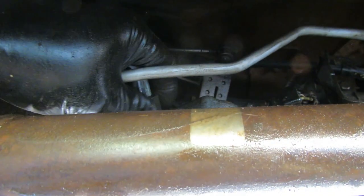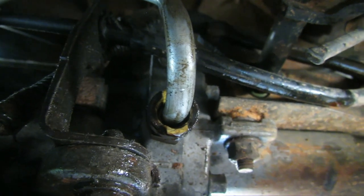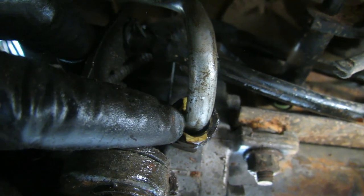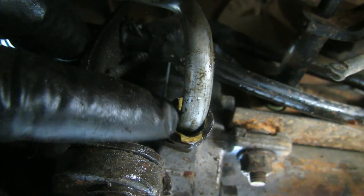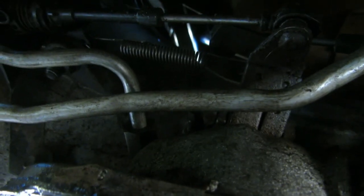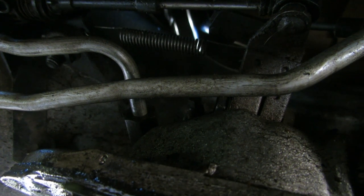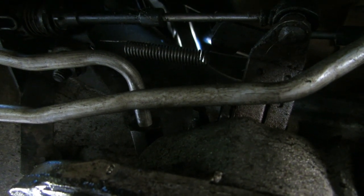This is going to be a 19 millimeter again on this nut. I wanted to show you — the line is not fully installed until that ring is fully seated inside the connector. I thought it was all the way in, double-checked, thought it looked a little off, and went ahead and fixed that. Now it's all the way in and this can't come out. I got that tightened down — 19 millimeter again — and did not need any thread locker because it's a flare fitting, so the flare takes care of the sealing.